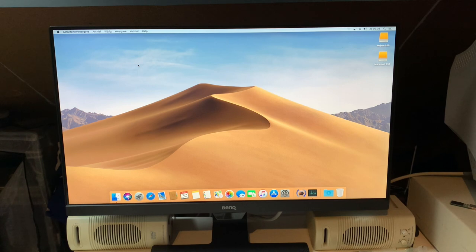Now, the reason I picked Mojave and not Catalina is basically because I do want this machine to retain the older app support. If I wanted really old app support, for instance, PowerPC applications or whatever, I could always just swap the video card back to the 5870 that will work under Snow Leopard and newer, and run Rosetta and PowerPC apps there, but I don't really see the need, personally, to run PowerPC apps that much. Because most of the things that I do on a Mac will run on the latest releases, and they're all Intel binaries anyway, so we'll be fine in that regard.